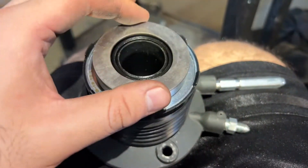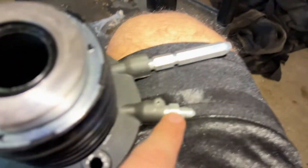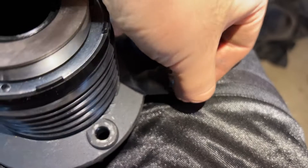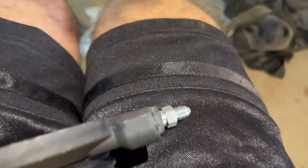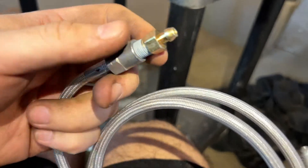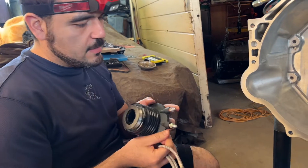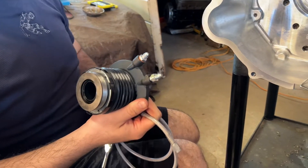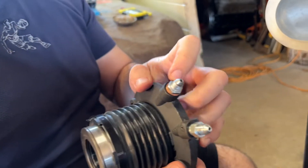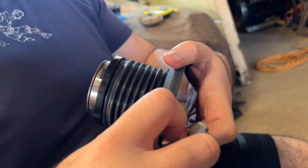Now that we have our 256 slave cylinder out, this is for the clutch master cylinder line. I don't need to take this fitting out or the roll pin — you just literally screw it on, which is a good thing. We have the line here and we're just going to replace the original piece with this line. This is the nipple to bleed from and this is the part that bolts on. We're installing the remote bleeder — it came with a fitting and a brass or copper washer. Just make sure the copper washer is on the slave cylinder side, as it goes between the fitting and the line.